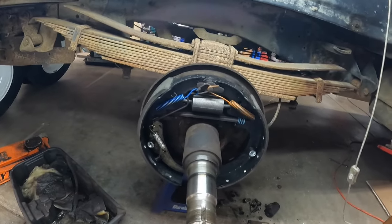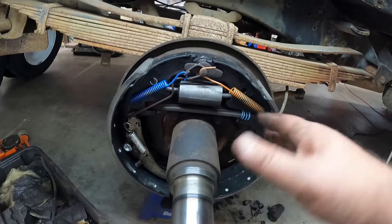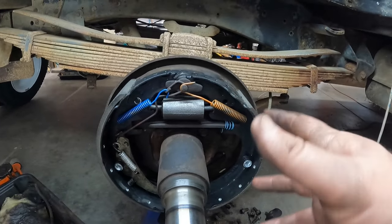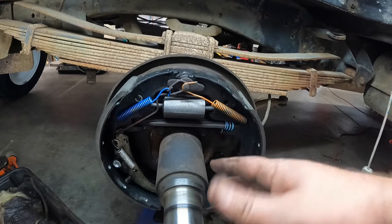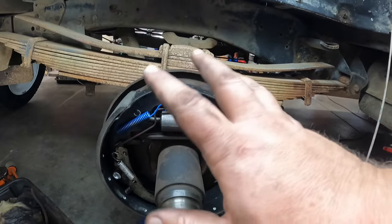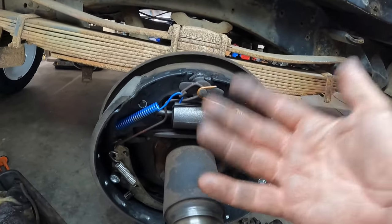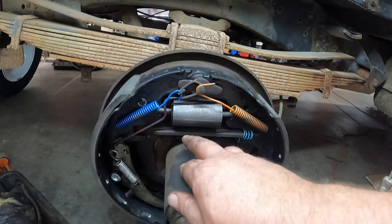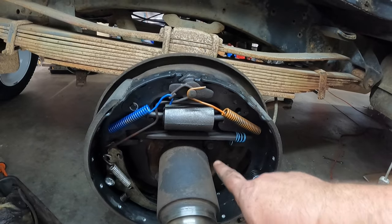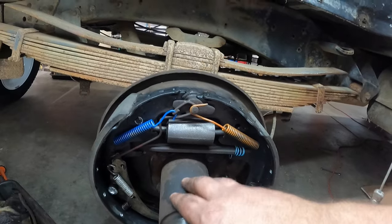This brake is pretty well complete. I had to move the camera and really get in there because everything was shifting and moving - really three hands is what you need for this but I've only got two. I had to really wrestle with it to get it settled in. One thing I did - which I do almost every time with drum brakes - is I had the little crossbar in backwards. It was hitting right up against the axle flange, so I had to take it all back apart, flip it, and get it back in. But everything kind of lines right back up and sits where it should.